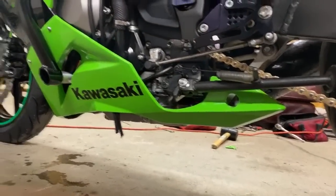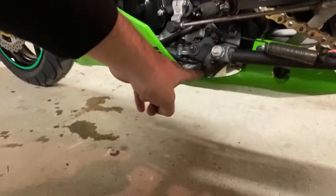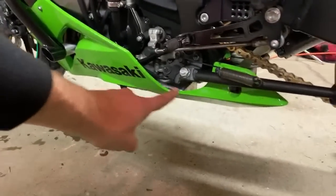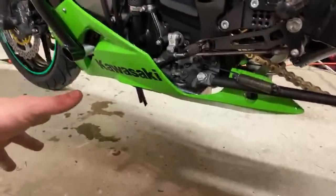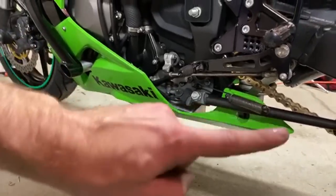This is my first time I've ever had to do this, because I do not have a Dyna, and the 0304 does not require it either. I did an oil pan mod. This is a bolt-on oil pan from, I believe, Stunt District? I'm not really sure. You can get it over at the Sick Shop, though. Nate over there will hook you up. It basically relocates this back portion to where the oil picks up from, right back there, so your motor isn't starving for oil on a wheelie with no oil pressure. You need that if you're doing rev limiter coasters or any type of long wheelies on this thing. That's just kind of a given.